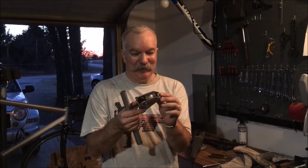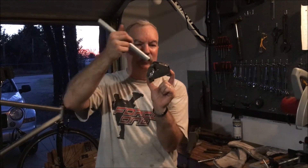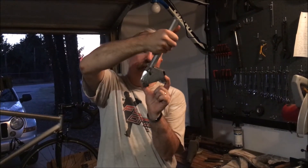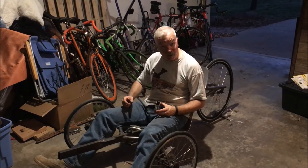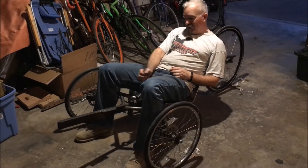This is my flight stick control bracket. It's really cool because I'm going to have a flange here and a flange here, so it'll rotate on the trike. This is just a stand-in for the flight stick itself — you'll be able to steer left and right, and hopefully connect the potentiometer of the Bafang motor so that when I'm sitting normally it's off, but when I pull it back it goes into a kind of turbo thrust mode. It mounts right between my original steering knuckle and the edge of the seat, and with the stand-in flight stick I'll be able to pedal along and steer left and right.